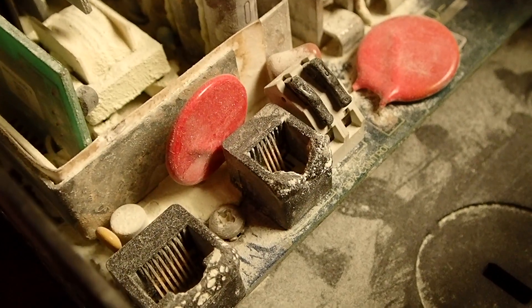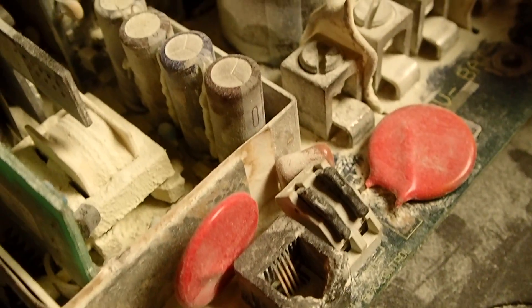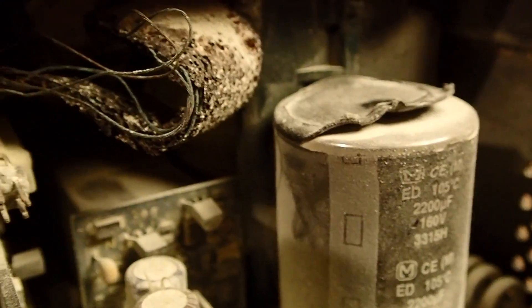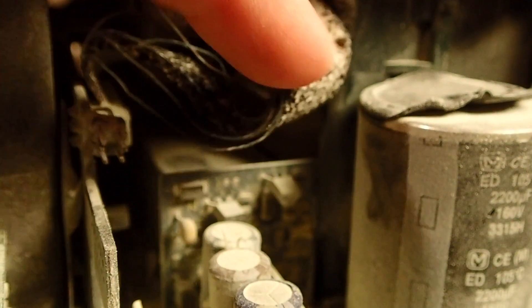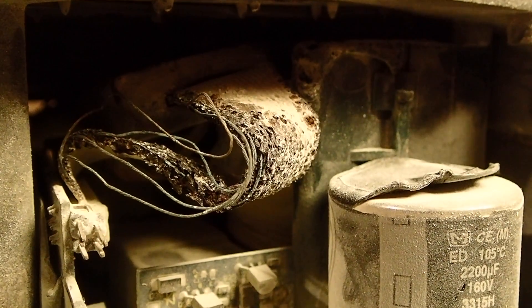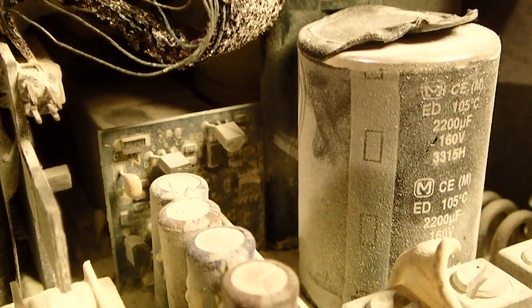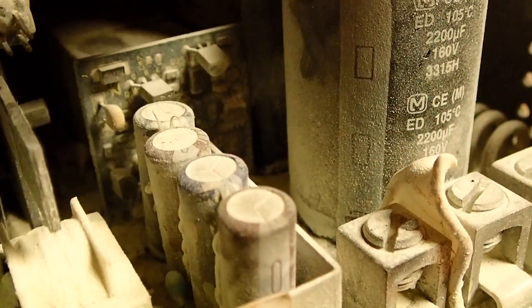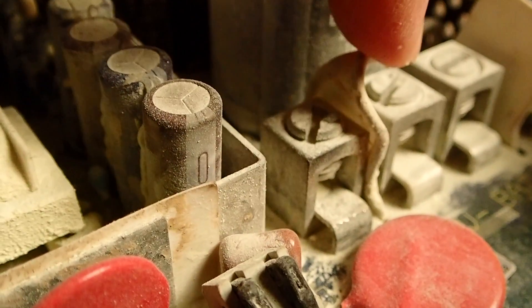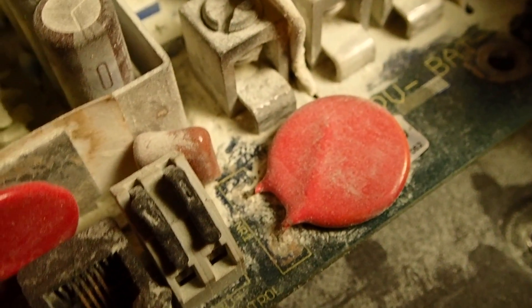Here's a look at the inside. You can see some obvious indications of melting — there was probably a short in some of the main wires coming in. The Ethernet jack and the phone jack are melted on the bottom. The plastic on top of a capacitor is melted off. Most significantly, that wire mess in the back is the wire going to the screen, and that ribbon cable is absolutely fried with wires just hanging out. The whole thing is caked with dust.